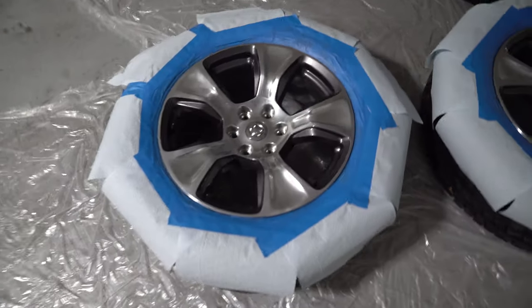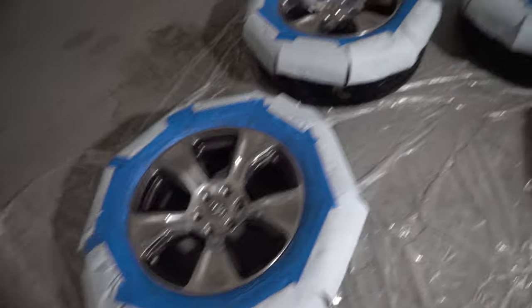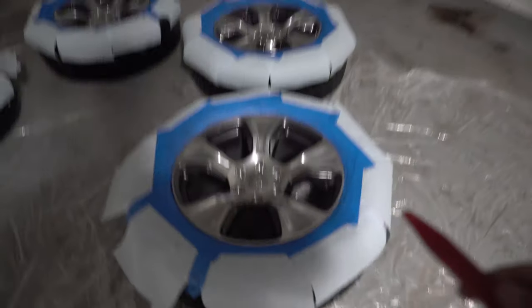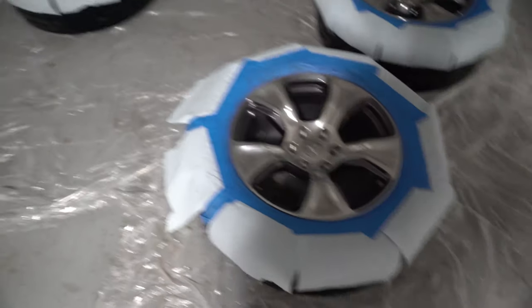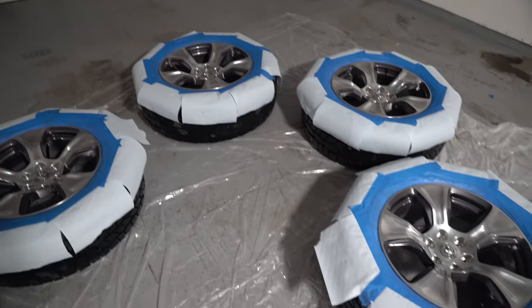The wheels are taped off, cleaned, and ready to go. We're going to do some of this prep spray next — that should get all the wax and grease off the wheels to make sure the DupliColor sticks to it. A little trick I just did was take a thin object, like this clip puller, and run it along the edge to make sure the tape is pushed all the way in. That way you get a nice clean edge of the removable coating right around the actual rim of the wheel. So I'm going to prep these for spray and then we'll get spraying.